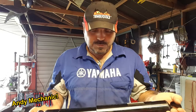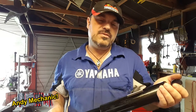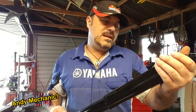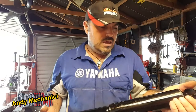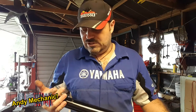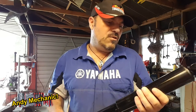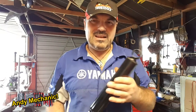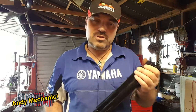Gas shocks, they're better. They tend to provide the same level of damping whether they're cold or up to operating temperature. And they do provide a tiny amount of lift to the chassis of the vehicle, but it's not really a lot, to be honest. Four-wheel drive guys fit gas shocks, get more height, but in reality, it doesn't really work. All it tends to do is smash the mountings that the shock absorbers go to.